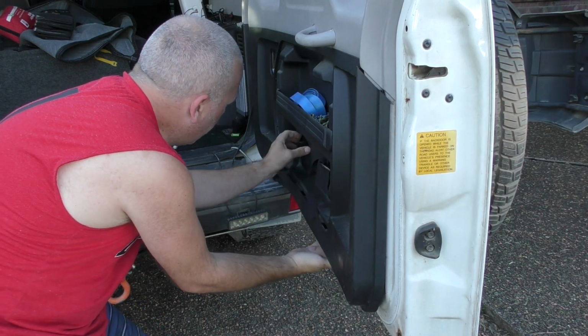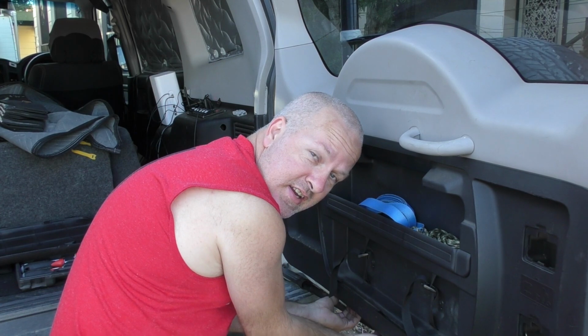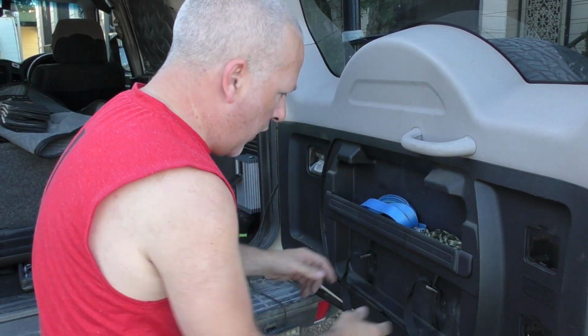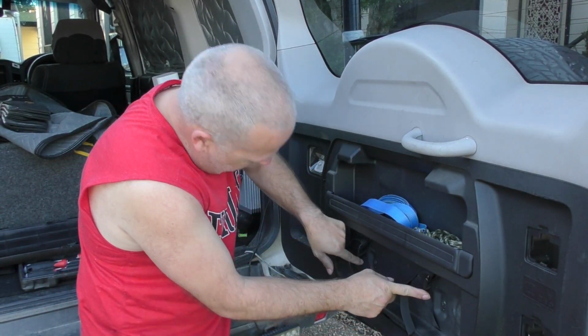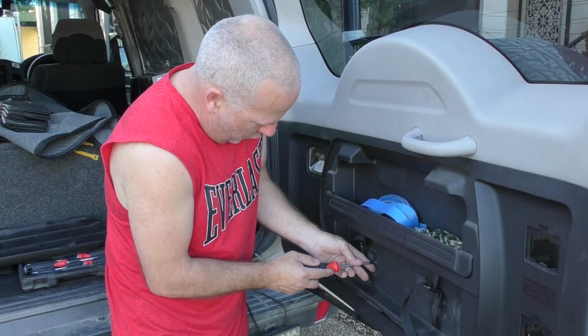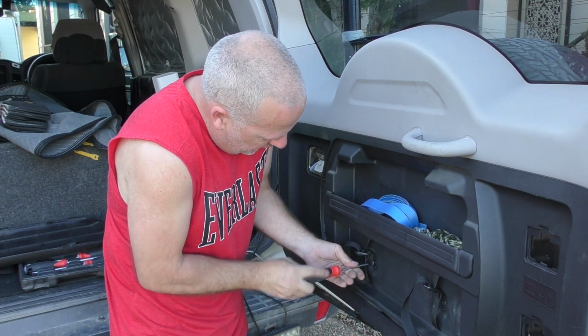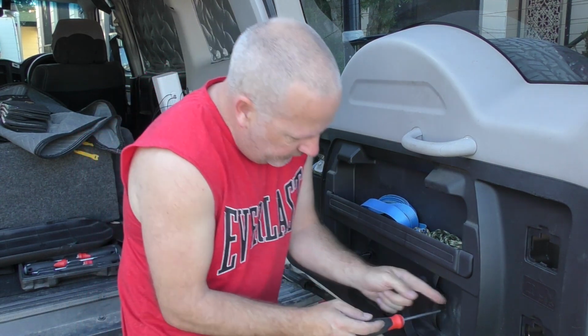There is something going on there. All right, if you're doing something like this, just go around and feel. Just grab it and pull. When there's pressure somewhere else that's holding on, don't force it. Stop and have a look. So basically, I felt some pressure here. I've popped these studs here and here, but I can feel it doesn't want to come away. So if you have a look just under here, it's a couple of Phillips head screws. Whether it's these holding on or not, I don't know. I think it very well may be. I'm just going to undo those.